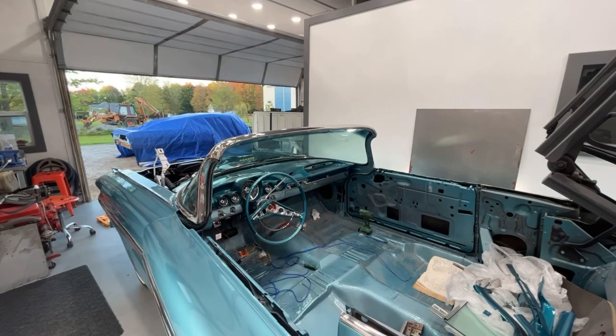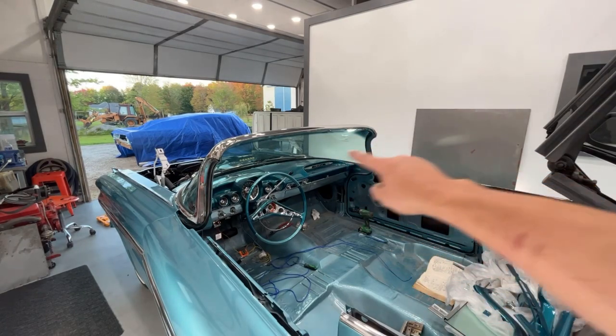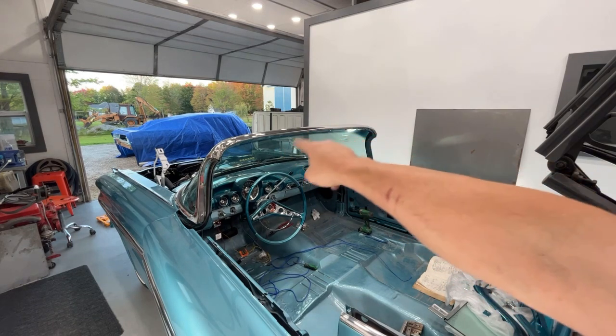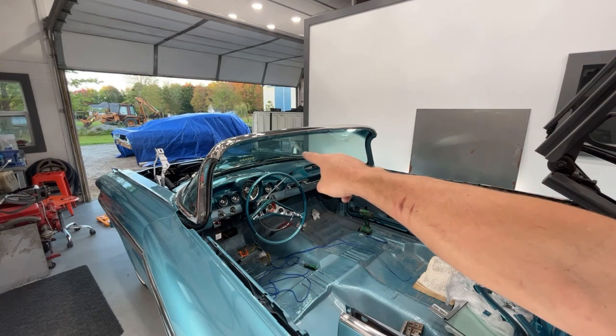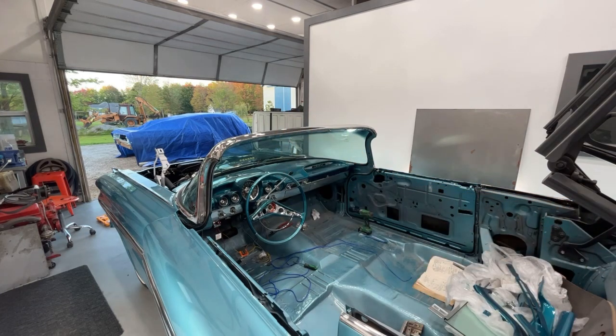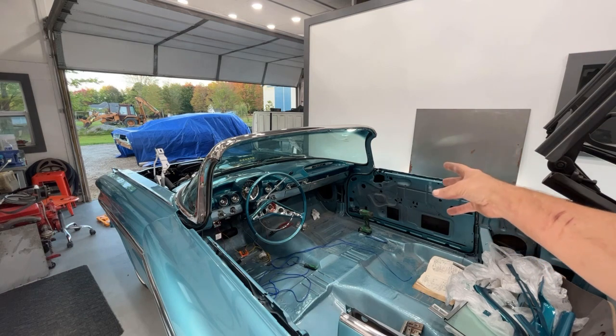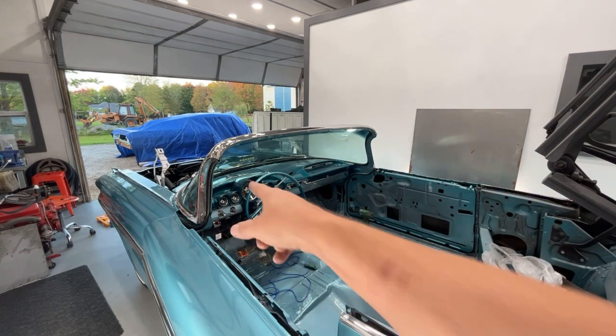Also this upper bow on the inside, it was off a little bit when I had it installed because the latches for the top wouldn't fit in right. So I had that metal off a little bit. So I need to pay more attention to that when I do it. I think what I need to do is along the dashboard first, then the inside pillars, and then the top last. I'm gonna mess with that for a couple minutes.